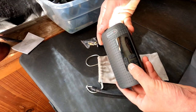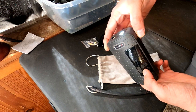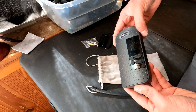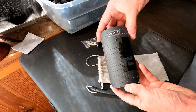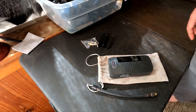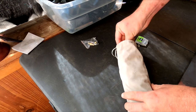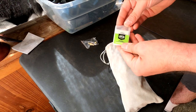Negatives aside, the light is bright and has an SOS mode. And because the battery in this thing is massive, if you just need it for a light, it's going to last a very long time. I'm thankful that the charging port is USB-C — these are a lot more common and easier to find now, especially if you have a phone charger. But don't try and plug it into a computer or a laptop; it draws too many amps. Use a dedicated power supply like you would use for charging your phone.